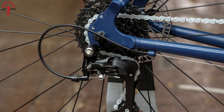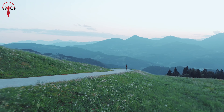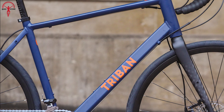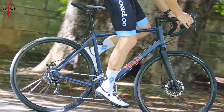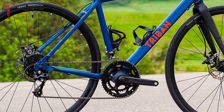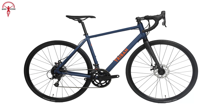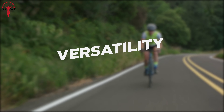When it came to gear shifting, the feedback was not very impressive. But for an entry-level road bike, the Triban RC120 gave us a fair response when we used the gears sparingly. As you can see, this bike is equipped with Shimano Tourney shifters, which are considered entry-level components. When we used the gears frequently, we experienced some challenges — the rear derailleur has a tendency to skip gears, and shifting the front derailleur requires significant effort. To avoid these issues, we limited our gear usage, and the shifting problems were largely resolved.